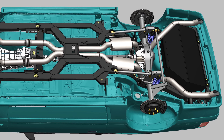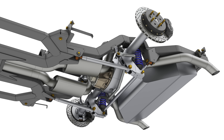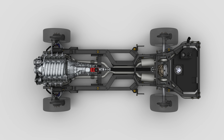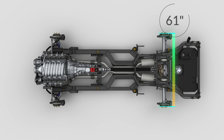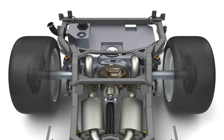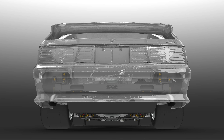On the rear of the chassis we went with a four-link setup with a full-length panhard bar, and ditched the Ford 8.8 for a Strange heavy-duty nine-inch. The standard track width is 61 inches from wheel mount face to wheel mount face. For guys who want to mini-tub their car, we offer a narrower 56-inch option — if you're running a 335 or 345 tire and mini-tubbing, the narrow option is the correct choice.